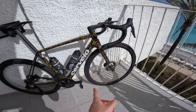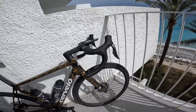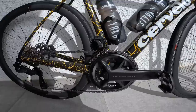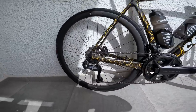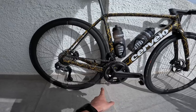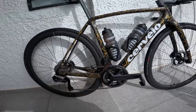I've changed this bike a little bit since the Everesting — new groupset, new wheels, and an inline seatpost as opposed to the 15mm setback seatpost that was on it previously. I've now gone to Ultegra 12-speed. This one is the Ultegra 50/34 compact, and I've got an 11-30 cassette on the back. I'm sorry the bike is filthy — I absolutely hammered it down while I was riding home. So 12-speed, compact chainrings on the front, and a mid-sized cassette on the rear. You can fit a large cassette if you want, but for me, for climbing and general riding, this works really well.